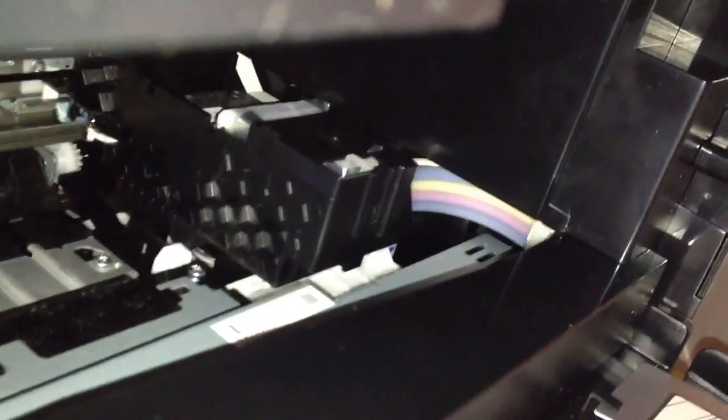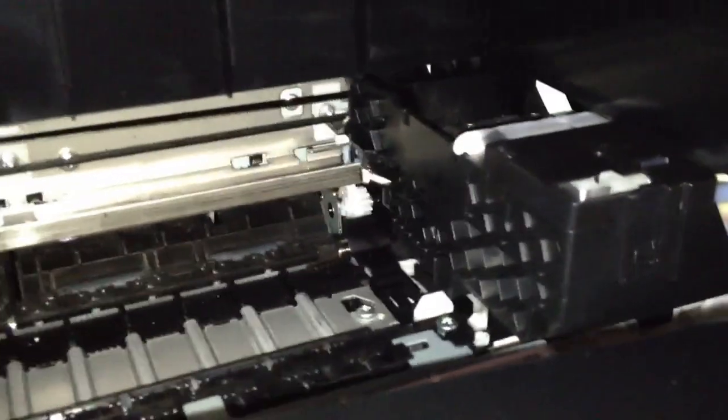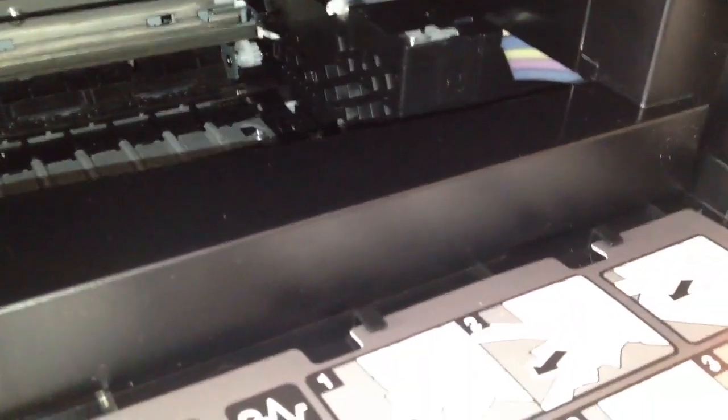So we'll skip that. Let's go inside. Back in there, it's hard to see. One second. So back in there, the little lines, little rainbow color, that's them. Now, one method you can do to kind of get at the print head, because you have to do this. One second. You'll close it. You want that little white lock to unlock, and then quickly pull the power off. Just disconnect the actual line.